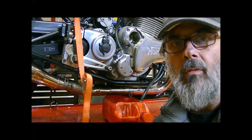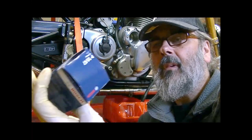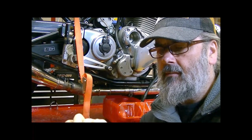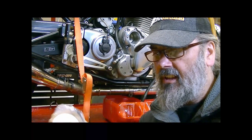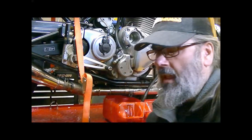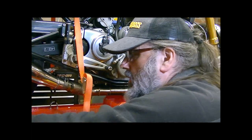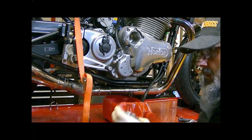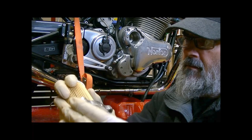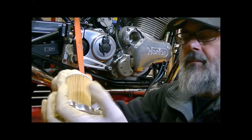So time to fit a new oil filter. This is the filter - it's a Bosch P9147, the new filter, which is fairly easy to get, certainly here in the UK because they're quite widely used. I think they also go in Mercedes-Benz. It comes with a couple of new rubber o-rings but I don't need them. So you fit the oil filter over the cap on the casing - that's a good snug fit on there. That's it, so that's it on.